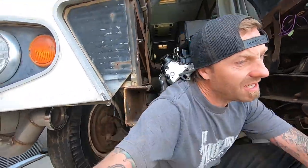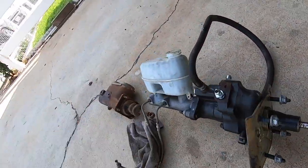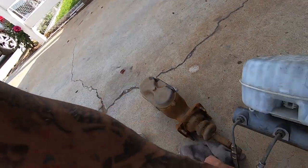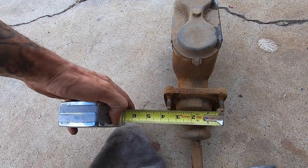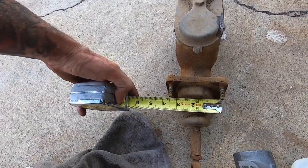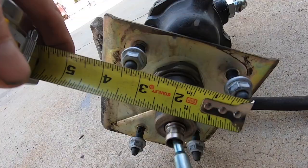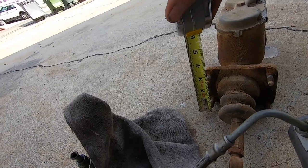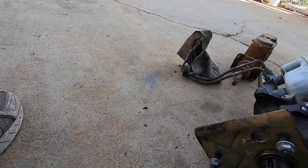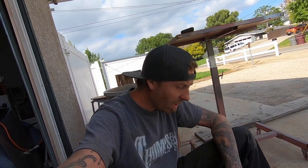So we don't fit length-wise — let's look at the width and the rest of the measurements. Width-wise, the top-to-bottom dimension looks like we're kind of off. On center, the original measures three and a half inches, and checking the donor — pretty much three and a half on center as well, maybe slightly oblong. Height-wise though, we're out of bounds: the original is about two and a half inches, and the donor is about four and a half inches.